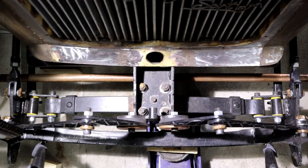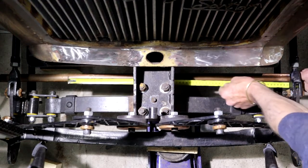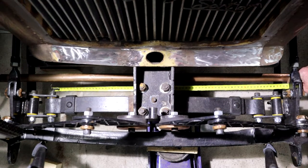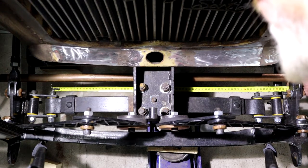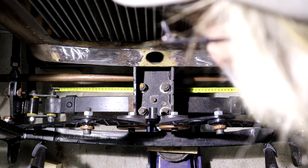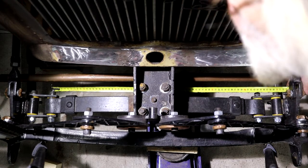I'm taking as many measurements as I can. I'm now going to measure that eye to eye distance again with the spring not under compression, so it's hanging clear and the weight of the car is sitting on blocks. And I am measuring 648 millimeters - not a lot of difference, but it's good to have as many measurements as possible.